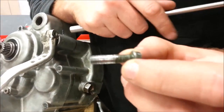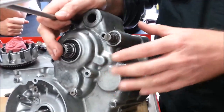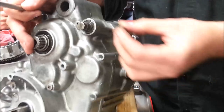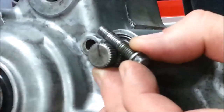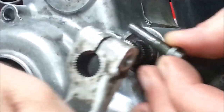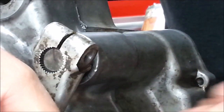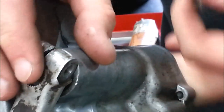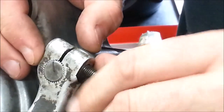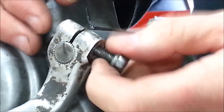Stripped — look at all the stripped aluminum threads in there. It was just being difficult. I even think that it might be bent. Usually what happens — you've got to remember you're going through that shifter and across here. If a person doesn't have this on far enough and they're not all the way on, they're stronger than those splines and can drag that across those splines and get it in there. Anytime you do this, you should be able to put this in free as can be and get all the way up to the threads. You should never have to drag it across the splines.